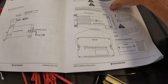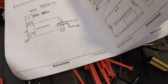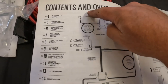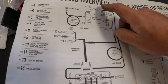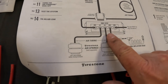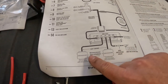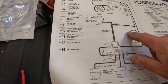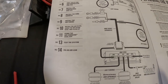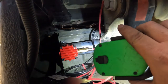There is the air compressor and the ECU — the computer. The master plan: you have an air filter that goes out, creates a loop, you plug it in here and back to the air compressor for fresh air. We have a push-to-connect straight fitting that goes to air tubing. This goes into the ECU that has left and right. There is an auxiliary port for a separate inflation hose. We have the airbags there, and this routes to a dry location. Then we have black, white, red to the battery — yellow is not used. There's an inline amp fuse that goes to the battery. That's the whole setup. The air compressor is right there and the control module is right here.